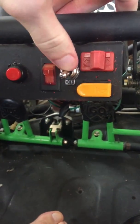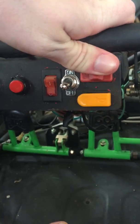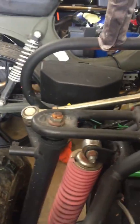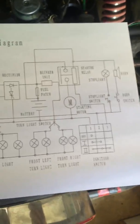I have an extra switch which I put in just because I broke one of my original switches. The horn works, the kill switch works, these are headlights, and then there's the ignition. For the headlights I just went ahead and wired it myself because it's so much easier than figuring out the way they have it done. All I did was run an extra wire onto the battery, ran it up to the switch, then split it so it went to each of the headlights.